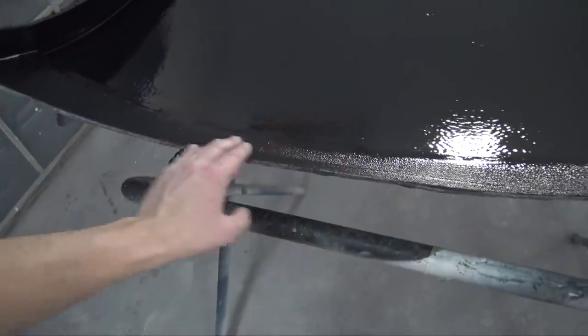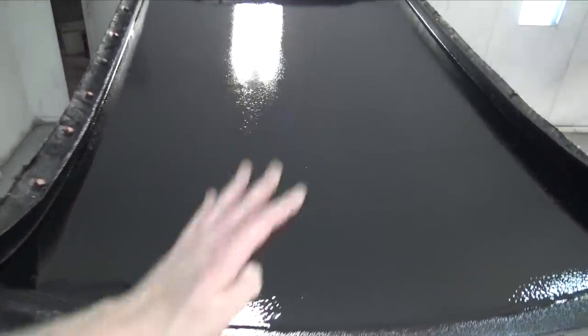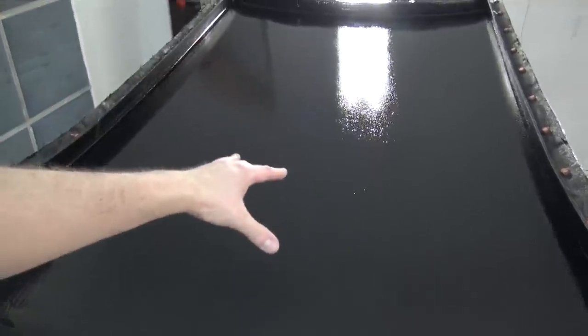So I'm gonna wipe it off and then put the bagging tape on, and then I can put the layers of carbon fiber. I decided I'm going to do 4 layers of carbon, so I'll do 1 layer of the 3K carbon Kevlar, then another layer of just carbon, then the Soric, and then 2 more layers of the 3K carbon.